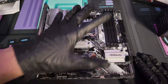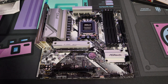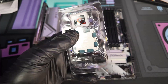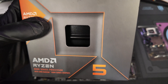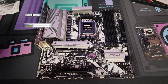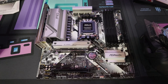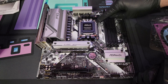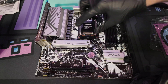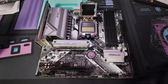It doesn't matter which component you start with, but I'm going to start with the CPU because it is the most involved. Carefully remove it from the box. If you got one like me, it comes with the CPU stock cooler, which I'll be showing how to install as well. When holding the CPU, make sure you're holding it on the sides and try not to touch the bottom. Next to the CPU slot there's a little lever — push it down and release it to open it up. Make sure there are no bent pins in that slot before placing the CPU in.